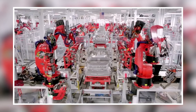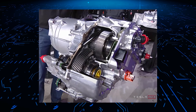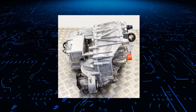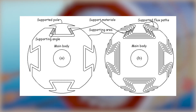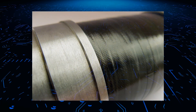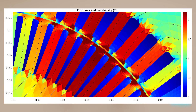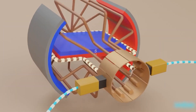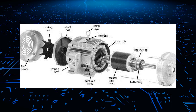It won't be a remodeling of any other car, but an original automobile masterpiece. The carbon-wrapped motor has a typical low-V shape that the Model Y did. Right at the tip of the V, there is no iron bridge between the magnets, and there seems not to be any bridge in the interpolar region either. By getting rid of the bridges, the Plaid motor uses a fiber sleeve to hold the rotor in place. This is important to eradicate the leakage flux path and allow the rotor to spin at greater RPMs. The magnets seem to be quite thick, possibly to drive enough flux over the gap. Since Musk has been re-emphasizing the role of copper in line with the carbon fiber sleeves, it can be implied that an induction motor is going to be used by Tesla.